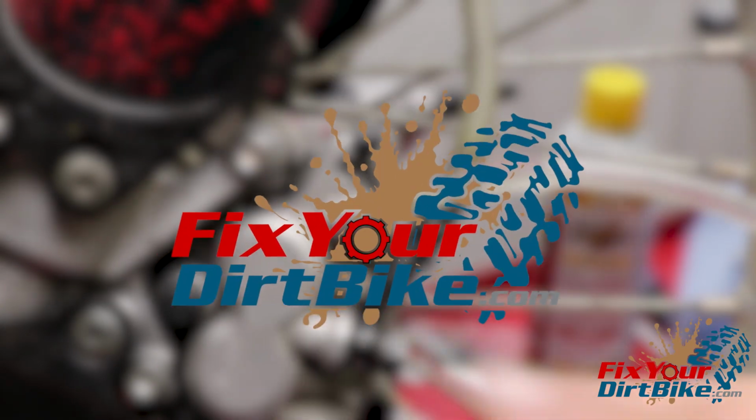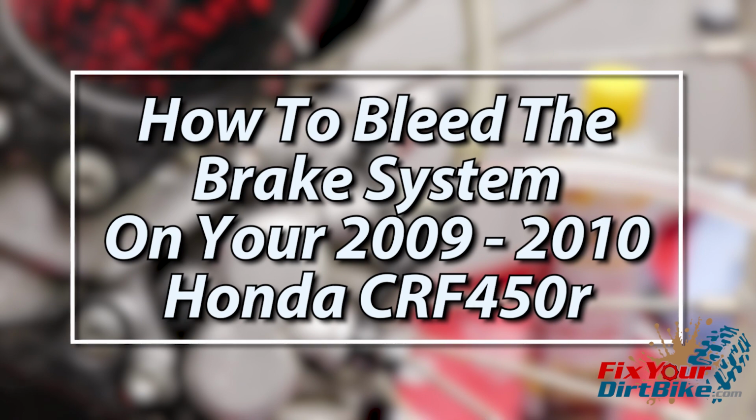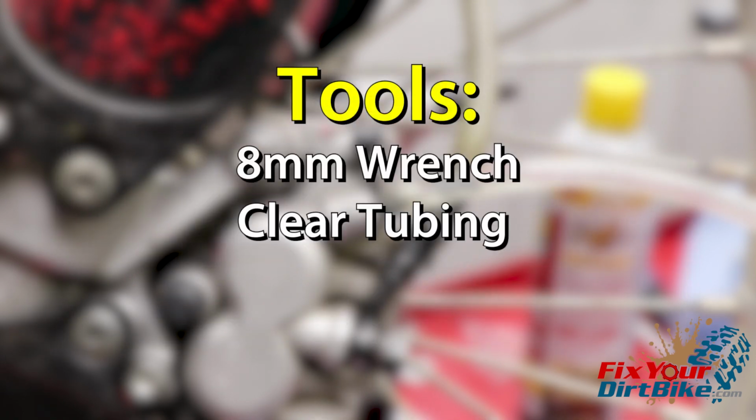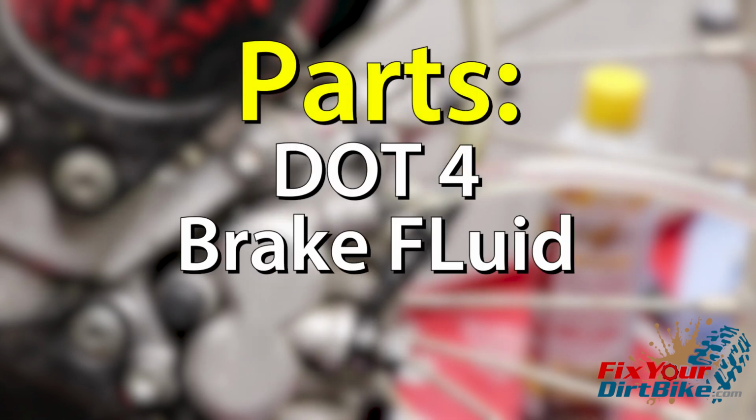Hey, this is John with FixYourDirtbike.com, and this is how to bleed the brake system on your 2009 to 2010 Honda CRF450R. The tools you'll need are an 8mm wrench, clear tubing, catch pan, and shop towels. The only part you will need is a bottle of fresh DOT 4 brake fluid.